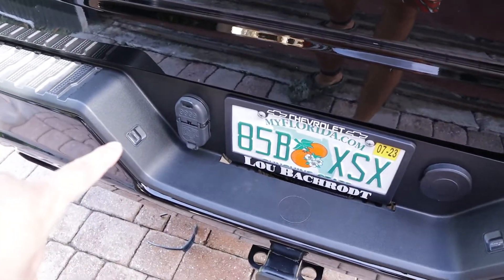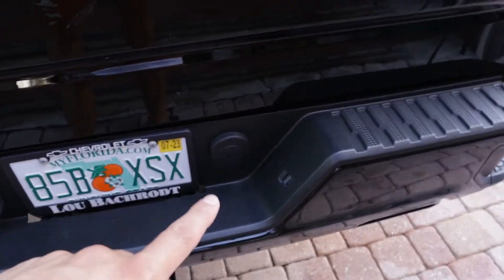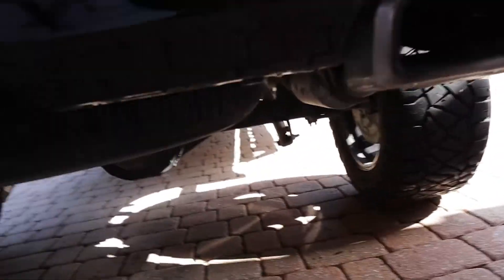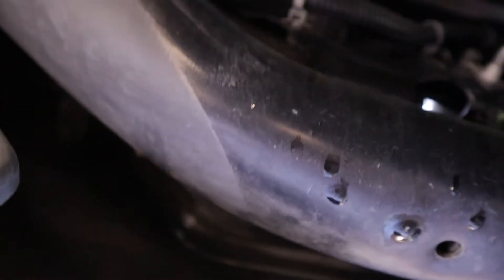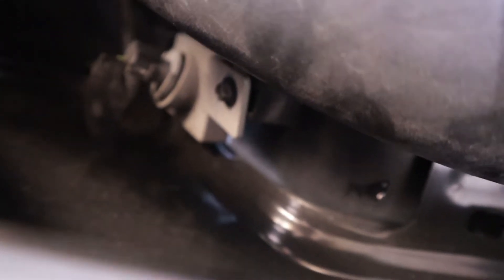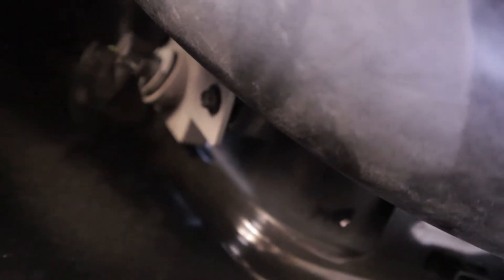The first thing we're going to do is install the license plate lights. One is out and they're just halogen — super dull. I'll show you what we'll be doing: you can see that plug right there, that's the one we're going to take out. Twist it counterclockwise, take it out, pull the halogen light out, then replace it with the new Last Fit LED. Pop that in, put it back in the socket, turn it clockwise, and you should be good.